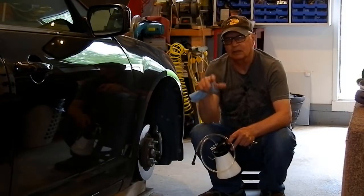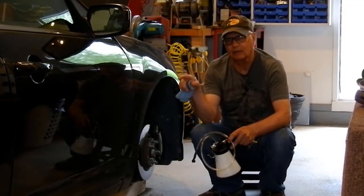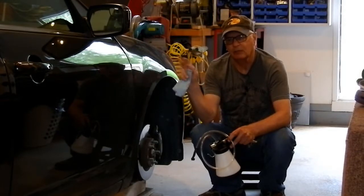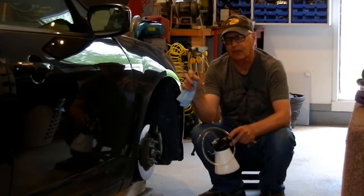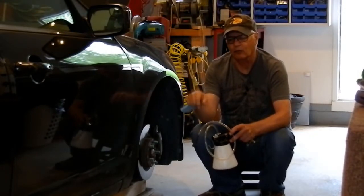That's what we're trying to achieve. You'll recall that I start this brake work with a preliminary brake bleed on all 4 wheels. Once the brake pads are installed, I depress the brake pedal a few times to refill whatever the pistons have to move to tighten up. And then I do a final brake bleed on all 4 wheels.